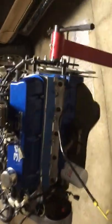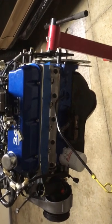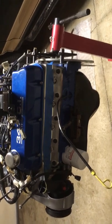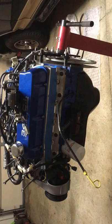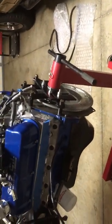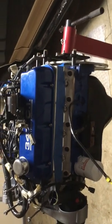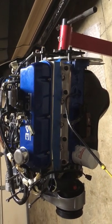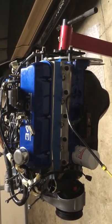As you can see, we've got the whole thing kind of taped off here with the front drive accessories on it. The biggest confusion we had when building this motor was when I asked the guys at Petite Racing over in Kannapolis, North Carolina to balance it to 50-ounce imbalance. Yesterday I was looking at the balance sheet — it says 50 — but the parts that came with it are actually 28-ounce parts. I called over there and he said they balanced it to match the parts on it, which are 28 ounce, so that's what we're going with.